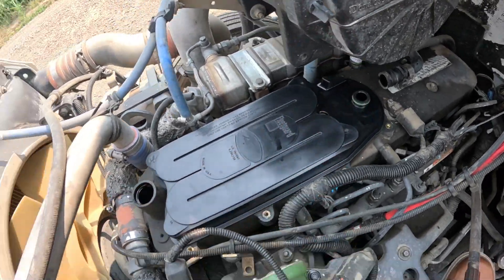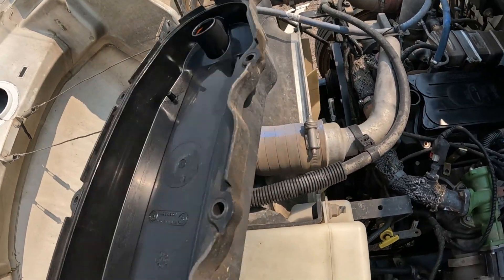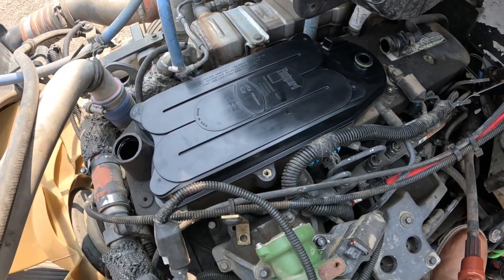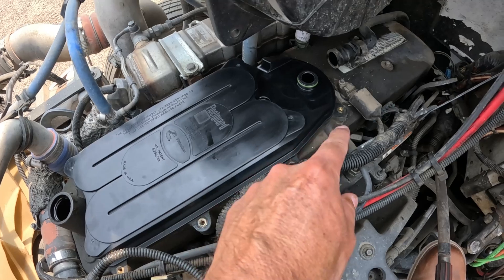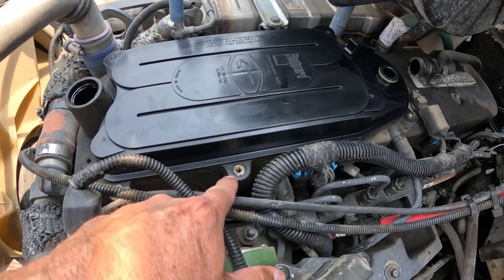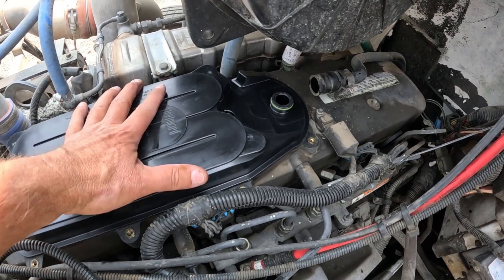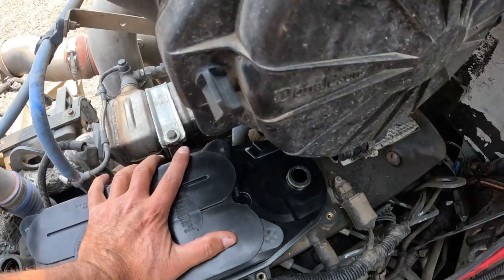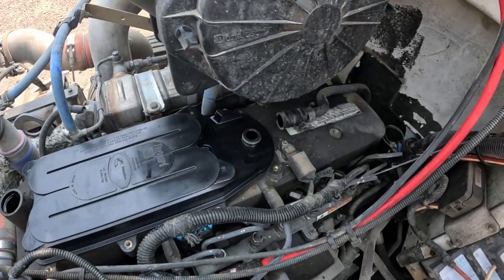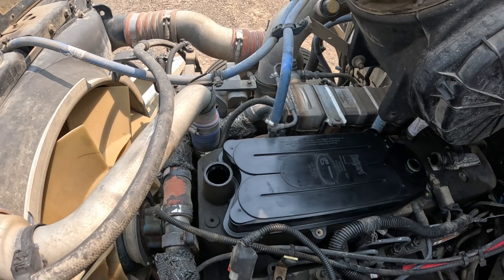This O-ring fitting will fit in the back of your cover here, and that's pretty much all there is to it. Now there's no torque spec for these bolts when they go back in, so just get them good and snug. As you can see, they're sitting in plastic, so you don't want to get overly aggressive with them. Just make sure this is down good, tight, and seated. Then put the cover on, bolts back in, breather tube back on, oil cap back on, and you're good to go.